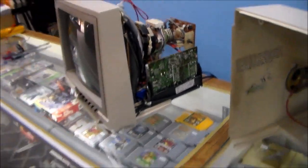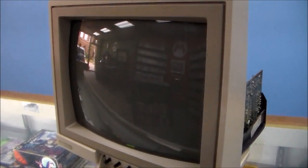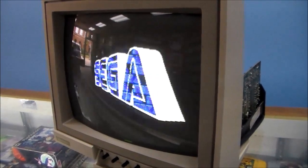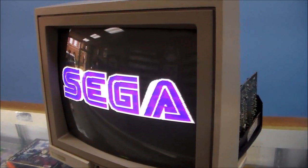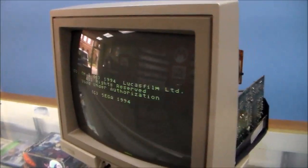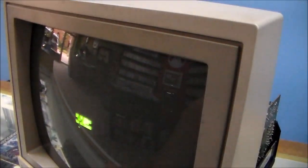So I put the resistor back in, put it all back together, and turned on the 32X. Look at that, folks — nice and bright like it's supposed to be! That negative 20 volts on the neckboard was the problem — since it was missing, that was it. You can turn the brightness way up now, and you can turn the contrast, so everything's cool.